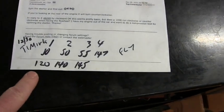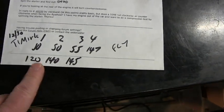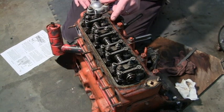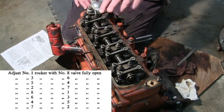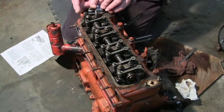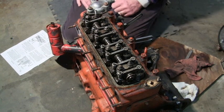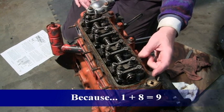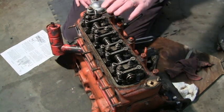When I first did this I got some strange readings: 120 on cylinder 1, 140 on 2, 145 on 3, and 147 on 4. So I was a bit concerned about cylinder 1, and what I did was check the valve clearances. With a four-cylinder engine you can check valve clearances using what's called the rule of 9. The valves are numbered 1 to 8. This is where you adjust each valve clearance with a lock nut and a screwdriver. If I want to adjust number 1, I need to make sure that valve number 8 is open — I have to turn the crankshaft until the pushrod is depressed all the way down, indicating the valve is open, then I can adjust number 1.